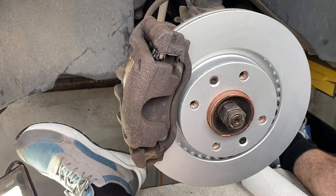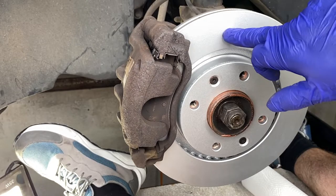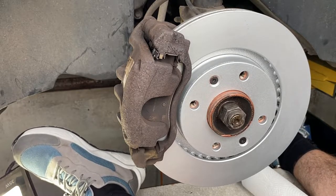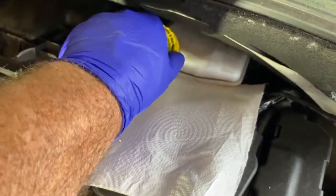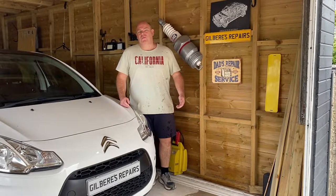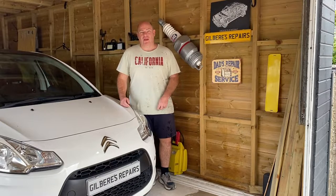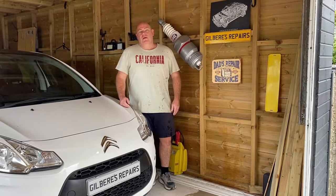Before you drive the car, pump the brake a few times just to compress the pads onto the disc, because we prised them apart in order to get the disc out. That's all that's required really for a straightforward job. We've just got to put the lid back on the brake fluid reservoir after pushing that piston back slightly to do the disc. We've got to put the wheel back on and take it for a spin. So that's the brake disc replacement — easy task I would say for your average home mechanic with basic hand tools. The next video is the brake pad replacement on the same 2011 C3. Remember if you've enjoyed what you've seen, to like, subscribe and share, and I'll catch you next time.